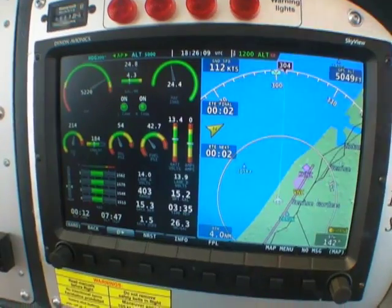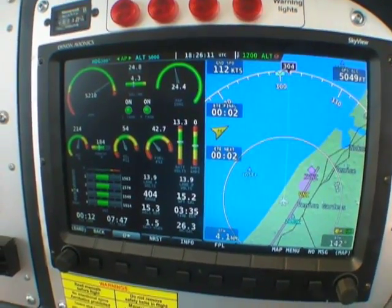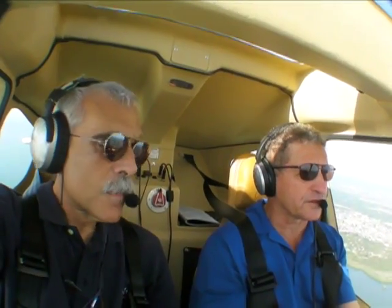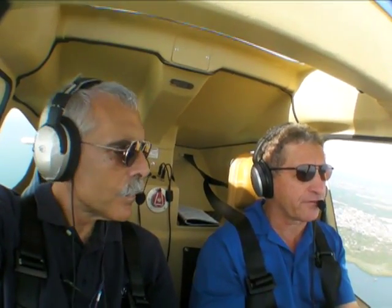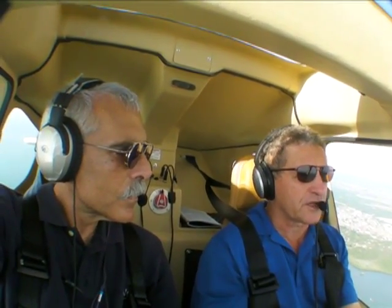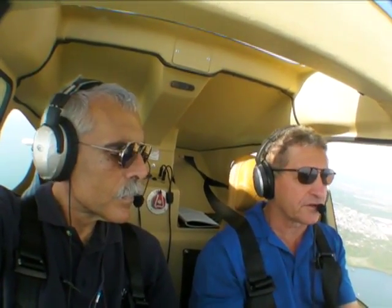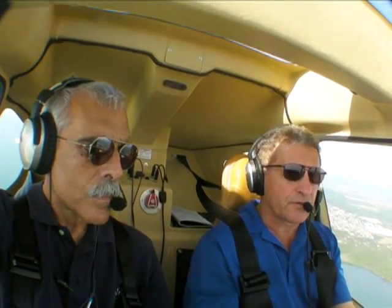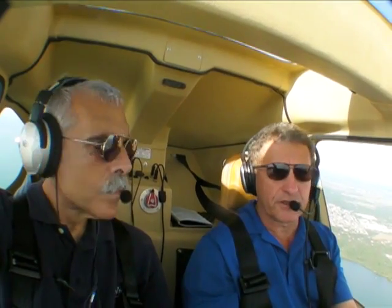The big payoff is at altitude. We went to 5,000 feet, set the airplane up in cruise, and got 114 to 115 knots on four gallons per hour — that's a good savings over the straight Rotax. When ferrying the aircraft from Connecticut down to Florida, flying at 4,500 to 6,500 feet VFR, it was consistently four gallons per hour at 114 to 115 knots true.